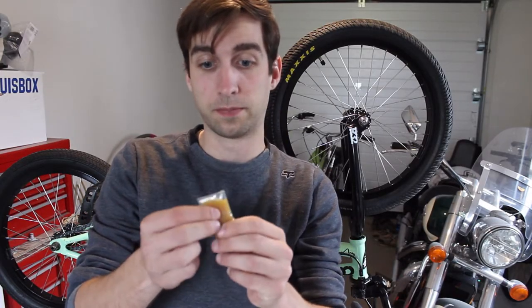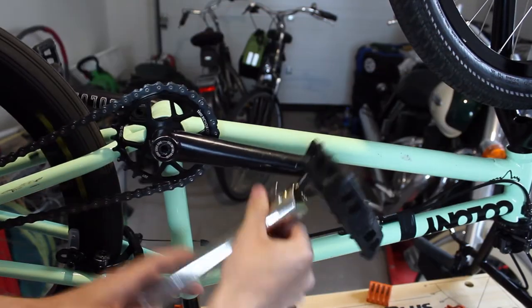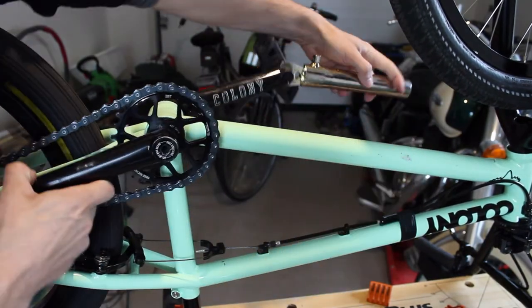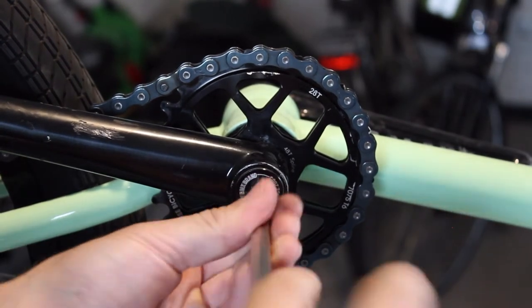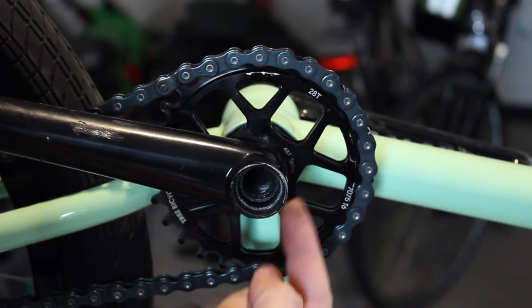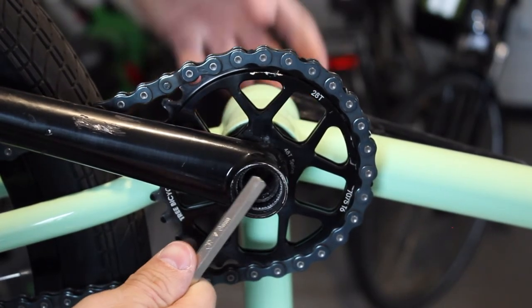The cranks come with grease, so you're going to need grease. First, you're going to need to remove the pedals. I already loosened mine. And second, you loosen your cranks. Now, every crank has a different system. If your cranks have a single bolt, like this two-piece design, it's easy. Some cranks still have pinch bolts, so you have to loosen those before you take out that bolt. And if you have a three-piece design, you'll have a bolt on the other side as well. I recommend just doing one side so you can slide the whole thing out together.